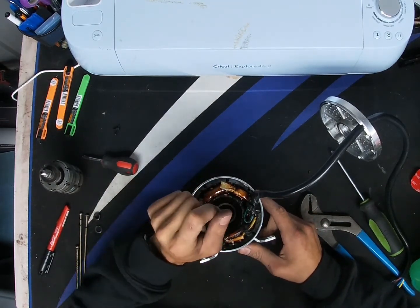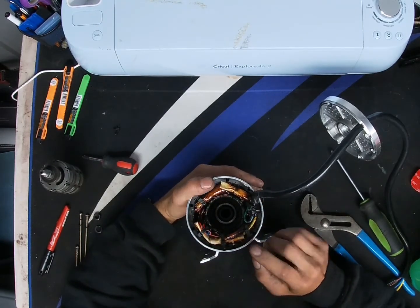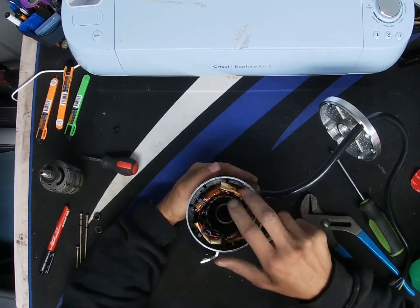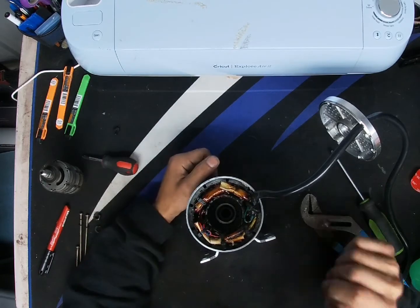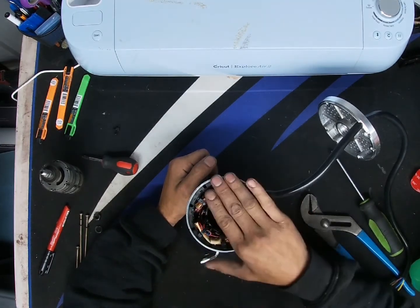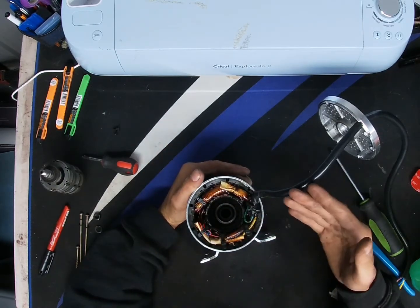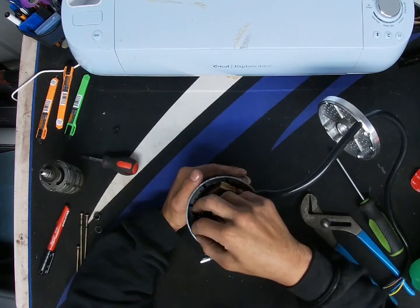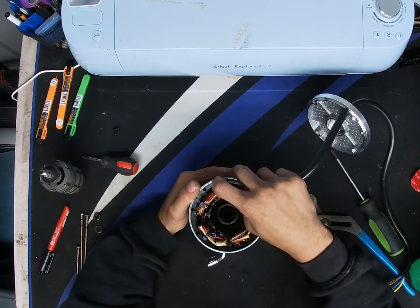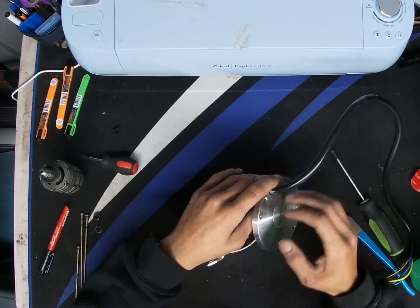They come with those speed switches. I usually knock those speed switches to number two, because you have three modes on the three gear selector. So I usually leave it in two, and I max it out like you're riding it, so you don't send too much power to the motor and basically prematurely wear out the components, which they should put in the description. You gotta wait a certain amount of miles to go this fast or whatever to push this much power. And the other thing as well is the vent ports.